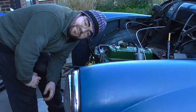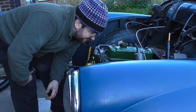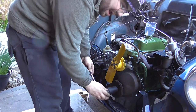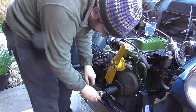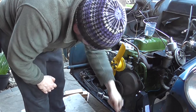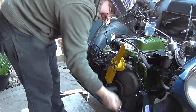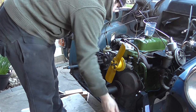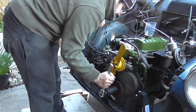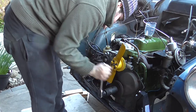This has been a very frustrating episode to film with all the technical difficulties. But we're now at the point where we're putting oil in the engine. The question is: will she start? Just going to crank the engine over by hand. The purpose of doing this is we're manually spinning the oil pump over to get oil into everywhere it needs to be before we try and start. The reason I'm able to spin it over so easily is there are no spark plugs in, therefore no compression. Should be good.